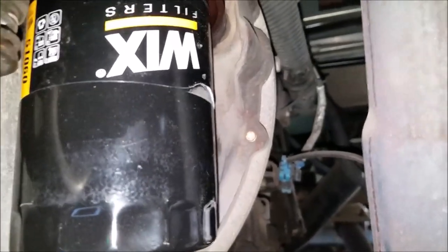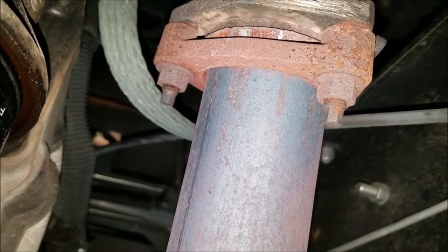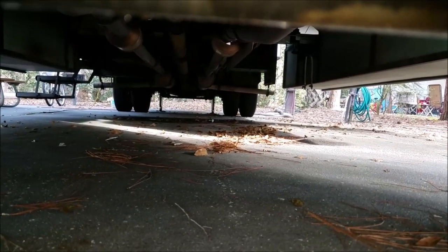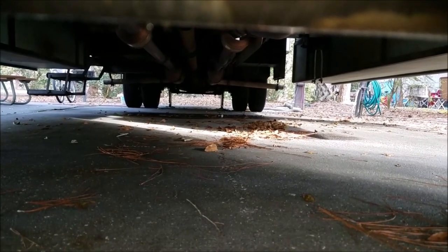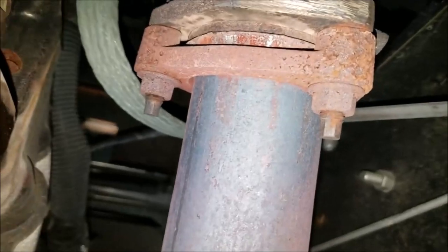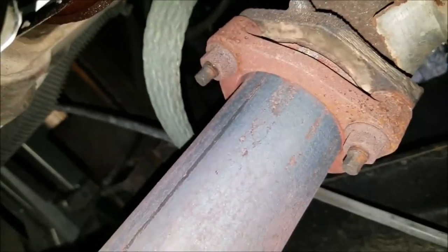I don't think it is normal. When I first saw this a week or so ago when I changed oil, my first thought was that this flange would be leaking. So I clamped some metal plates in front of each exhaust pipe — just some aluminum — to create some back pressure. Then I came in with some incense and smoke to allow it to flow around the flange, but nowhere was there any indication that it was leaking. I can get under here and shake the exhaust and it's as tight as a drum.